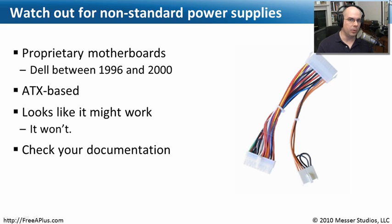Unfortunately, not all motherboards are created equal. A number of manufacturers — Dell is a very good example — between 1996 and 2000 created their own proprietary motherboards. You still see them from time to time, not just from Dell but from other manufacturers too. These motherboards aren't standard ATX or BTX; they are something that organization created very specifically for themselves. If that's the case, you may find that the power supply and power connectors on those motherboards don't follow the standards. The connectors look very similar, but it's not going to work — if you try it, you'll be in trouble.